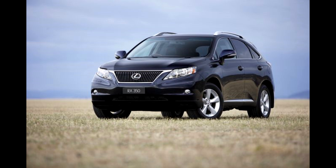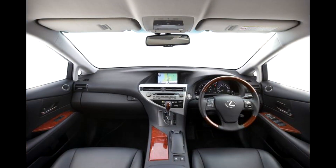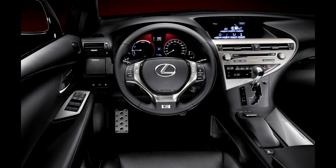Now let's focus on some of the attention points of this Lexus. In general the reliable image of the Lexus stands firm, but there are a few things you should know before buying this RX. Starting with the interior: the remote touch mouse control is not very convenient to use, especially when driving. Next to that, there are some reports of cracked dashboards, especially a problem with cars that drive around in sunny and hot countries. Keep this in mind when you consider importing an RX.